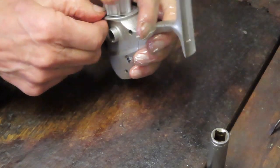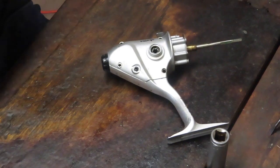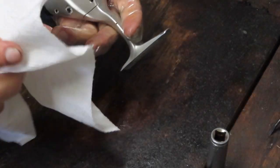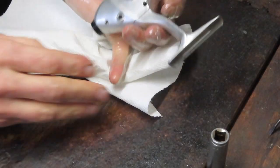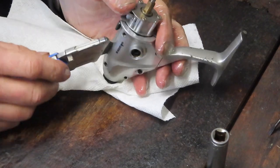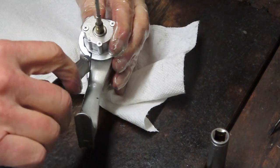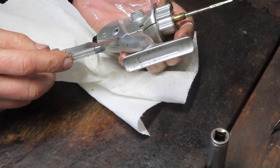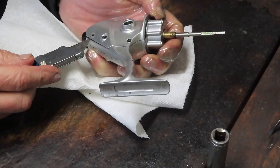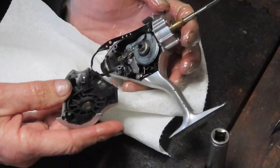Now we should be able to remove the side plate. I'm using a razor utility knife just to separate the case — be careful not to scar the paint. Don't be aggressive; just slide it in as a little wedge to pry it apart. You've got to come up over that little trip mechanism piece there. I can see a lot of accumulated buildup right on there — that's the issue.